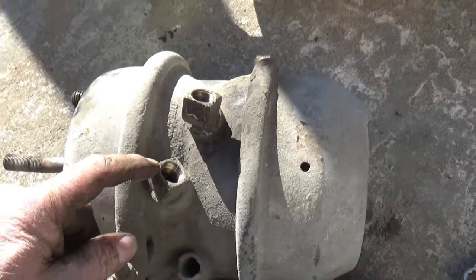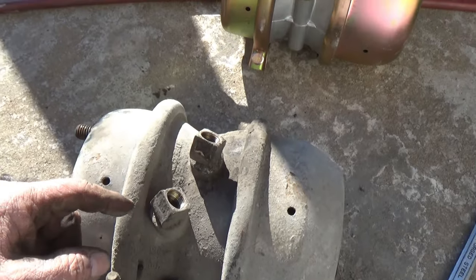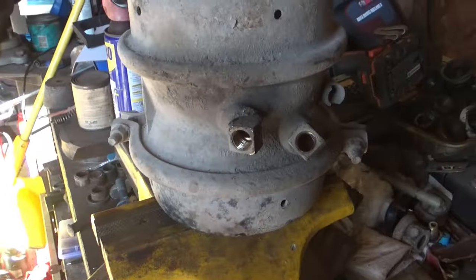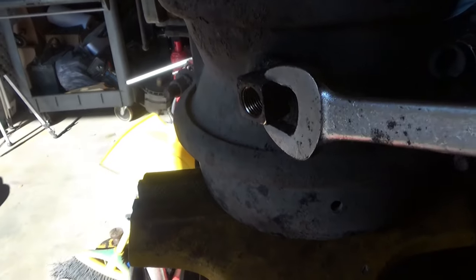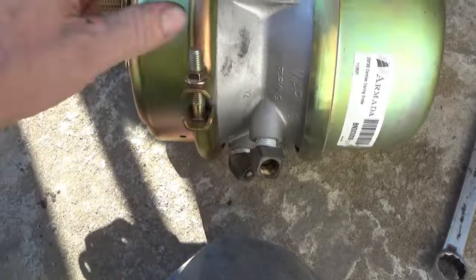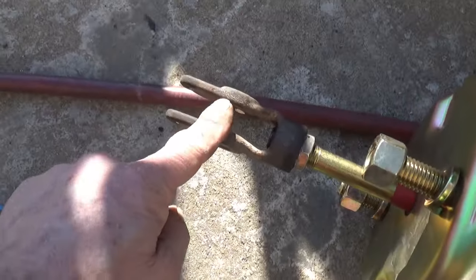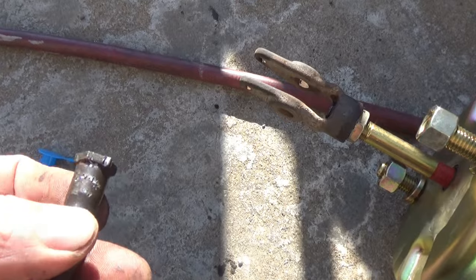I've got to get my smartphone out and take a quick picture of the position of these brass fittings so that I don't forget how they are. I'll wrap a little bit of Teflon tape around the threads. I should have broken these loose while it was still mounted on the truck and taken a picture down there — now I have to put it in the vise to break them loose. Not everybody's got a vise this big, but I'm thankful I have one. I can't use the new fitting because it's too short and won't reach. This one is wider and has a hex head to help grab and turn it while pulling it out, though it's a bit buggered up from fighting to get it out.